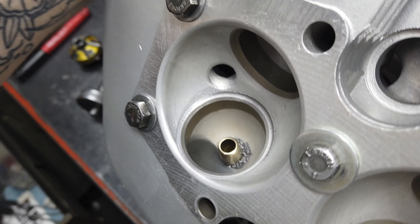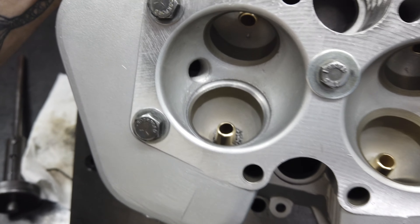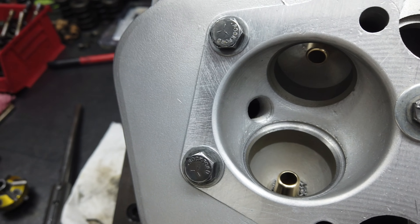I stopped here to show you - I did a few passes and there's still just a little bit of the original face of the seat, then you can see the new fresh cut over here. Got a little ways to go yet before I've got a full clean 45. Done a little bit of 30 and blended it nicely. I like using the hand cutters because I can actually tell how it's cutting - the grip, all that kind of stuff. I'll continue on and update you when something else changes.